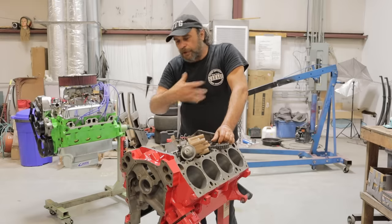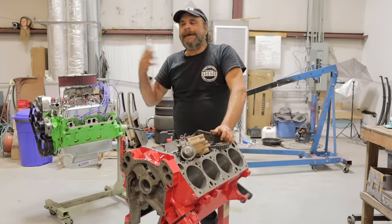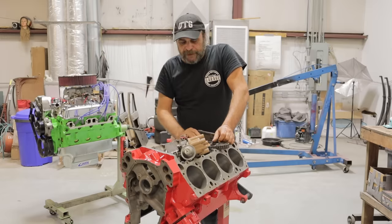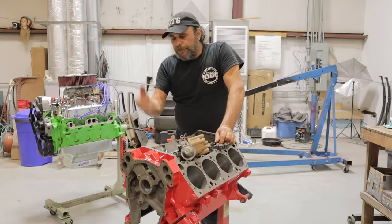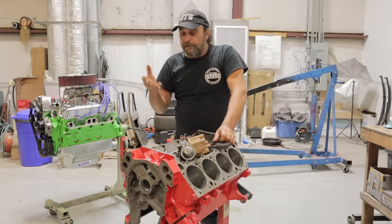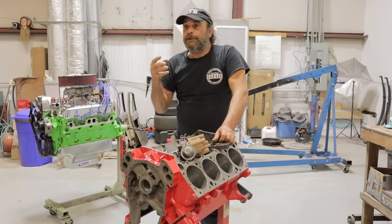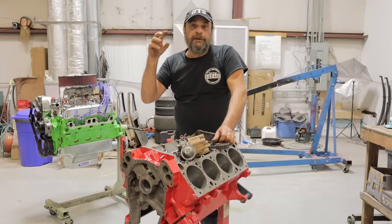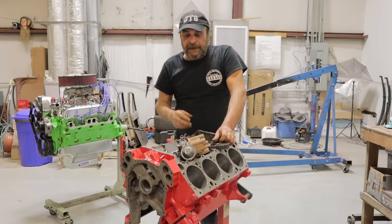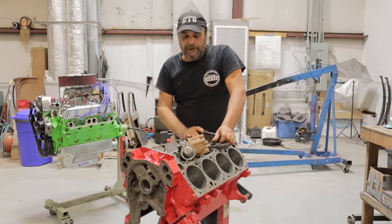The best way is to pull the motor apart and replace everything fresh, but that's not realistic in most cases. In most cases you have an original engine that runs okay, it's not bellowing smoke, and you just want to make it run as best as you can. Compression ratio drops — the dynamic compression ratio. The static compression ratio never changes because that's just a group of measurements. But the dynamic compression ratio, which includes cam timing, valve seal, and ring seal, does change and over an engine's life it diminishes. With lower compression, the engine needs more ignition timing.